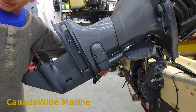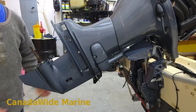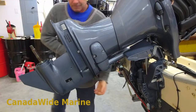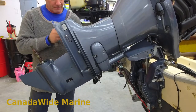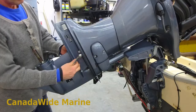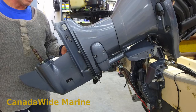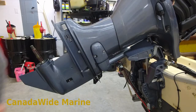We'll have water spraying up out of this tube here if we don't. And then there are four bolts — two on this side, two on the other side. Take them off. Servicing your lower unit — changing your gear oil, water pump impeller, greasing your drive shaft splines, and greasing your propeller shaft splines — should be done every year. We do this every year for all of our customers' boats. It's recommended; it's in the owner's manual.